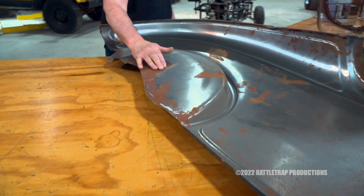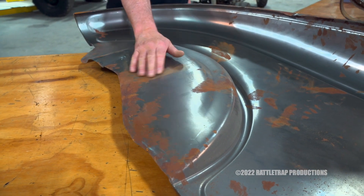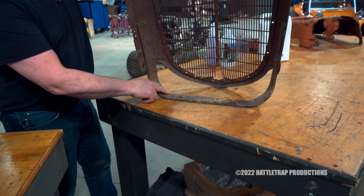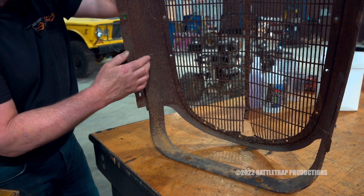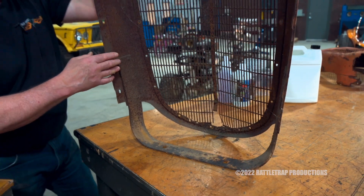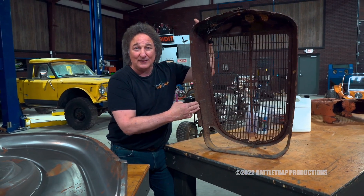But what if it's just light rust like this on the surface? That is called surface rust and it's not hurting anybody right now. But if you let that go, it eventually gets worse — it starts to pit and gets deeper. Eventually those pits turn into pinholes and you end up with rusted out metal. So the idea is to stop that process while you still have good metal.